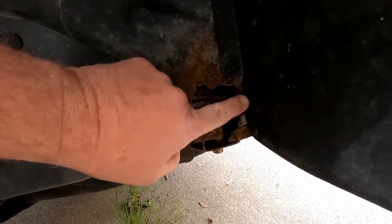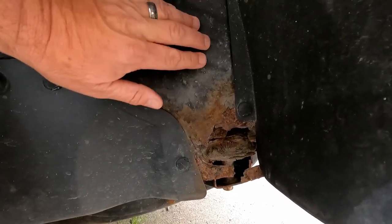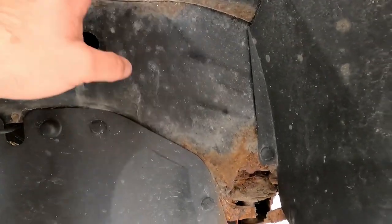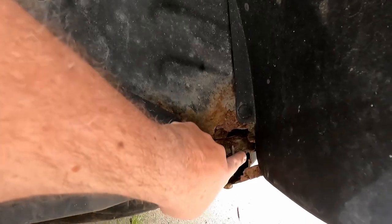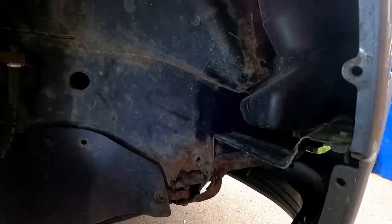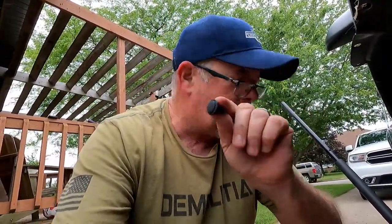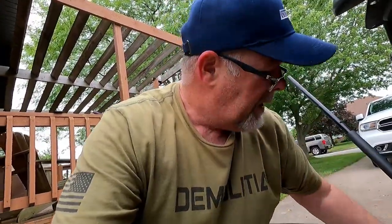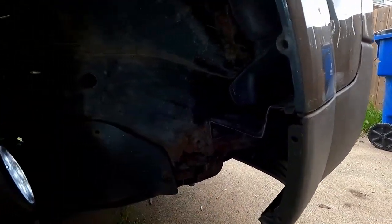Let me bring you in a little closer to show you what I'm talking about. We're going to take this cover off and just pull it back a little bit. This is all part of the frame — all this metal up here is tied in with this right here, so we're going to have to probably weld up here and down around here as well. We took the inner fender out — it's held in by plastic clips. I used an old screwdriver modified with an angle grinder to size it and pop them out.